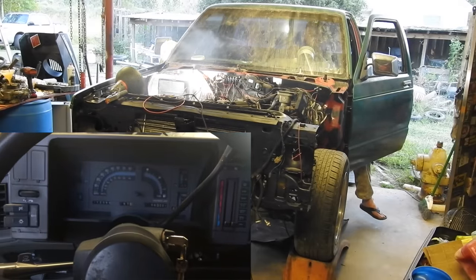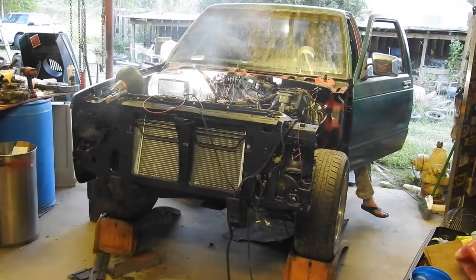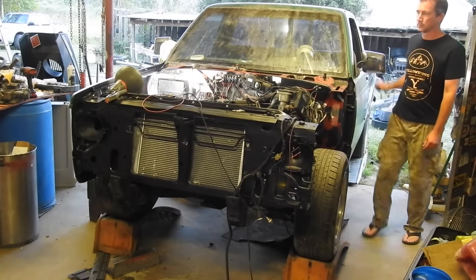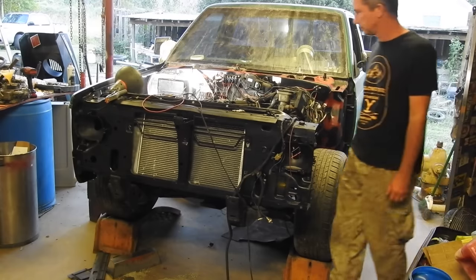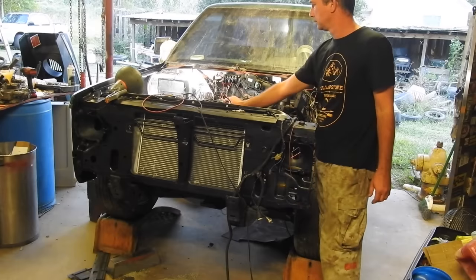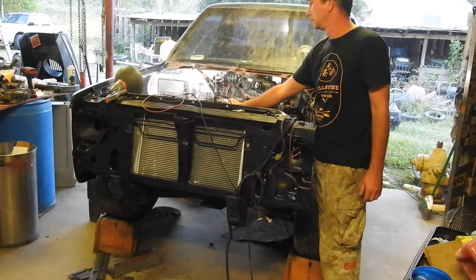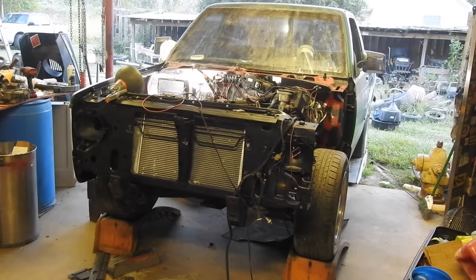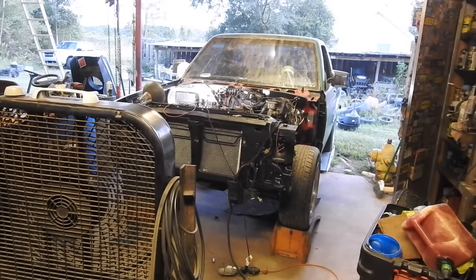Just remember, there's a spark plug wire off. Stand by. So I think I'll bring the other fan over, try to blow some of that smoke out. We need to get it off the ramp, see if it'll go in gear. And then while we're at it, I'm gonna look at the transmission dipstick, check the power steering fluid again.